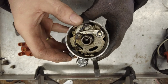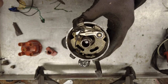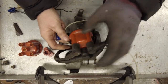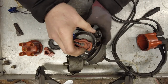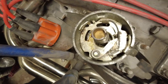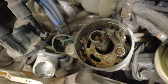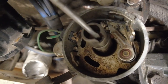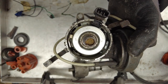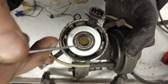The next one was something I didn't know about either. In the middle of the shaft there should be a blob of felt or a felt pad. If I just get another dizzy — this particular one is from a CT, a late one with no points — in the end of this one there's a felt pad. I checked the one on my engine and this one has a felt pad too, sitting in a slightly different place. In the centre of all these distributors — any that's got a mechanical advance, so that's basically all of them: SVDAs, 009s, even the late CT one without points — you'll find these felt pads. They basically help lubricate the mechanical advance below in the shaft.